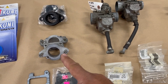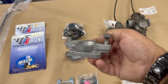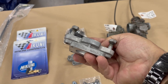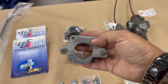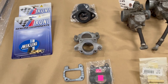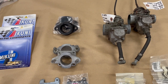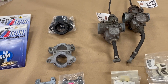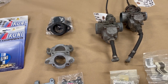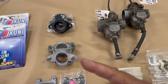This is the most important part of this dual carburetor project — to get these Mikuni adapters. I picked these up from a friend of mine. I have not been able to find these otherwise; I just got lucky finding them from a friend at a swap. To do this dual swap, you're going to need these adapters. There are some phenolic ones that were made — I've only seen pictures of them — but these adapters are key.